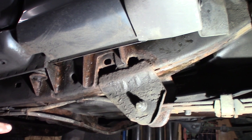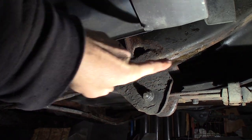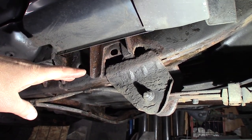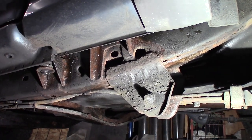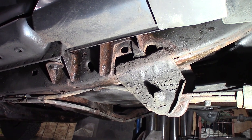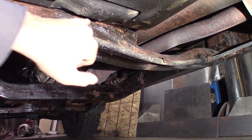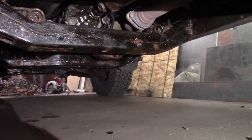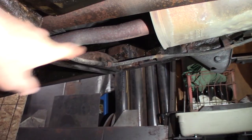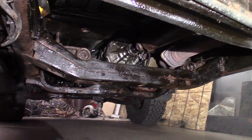Let's get onto the truck and take a look. Here's the rear front of the spring hanger on the driver's side — there's a huge hole here, hole here, several holes here. This frame was completely loaded with water and scale and garbage when I fluid filmed it, and we spent about an hour and a half cleaning the inside of the frame out. The Z-Bart rubberized undercoating completely sealed up all the drain holes and just caused the thing to hold water and destroyed it.